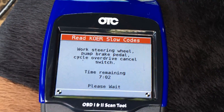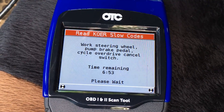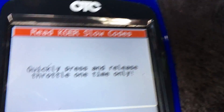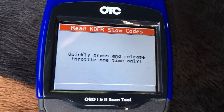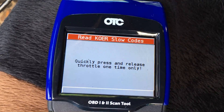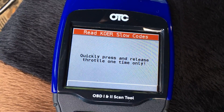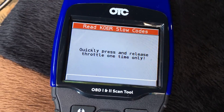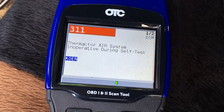The idle's coming down — usually that means it's towards the end of the test. It might cycle again to test the EGR or something. There it is, the throttle push — one time only. Look at that, it's beeping the fault codes for you. I think this scan tool is much better suited for OBD-1 for sure. And from what I've experienced with it, OBD-2 does quite well too because of the faster data streams and more compatibility with newer vehicles. There we go — that's the end of the test.